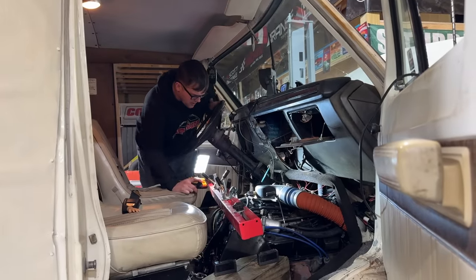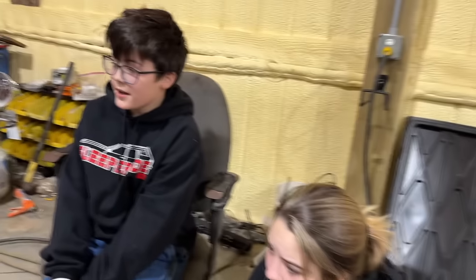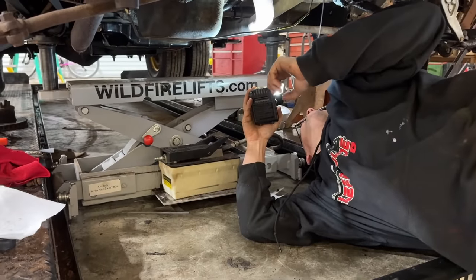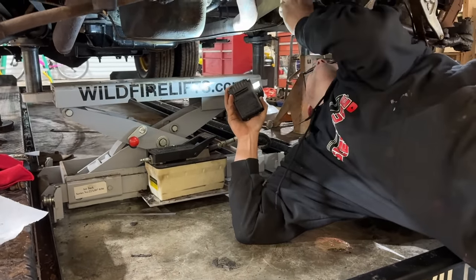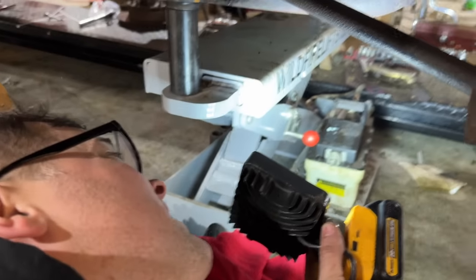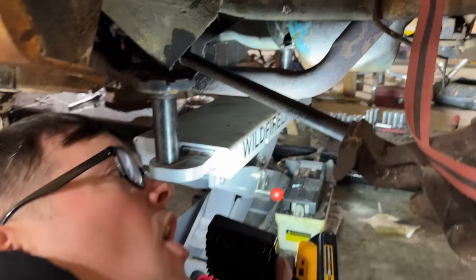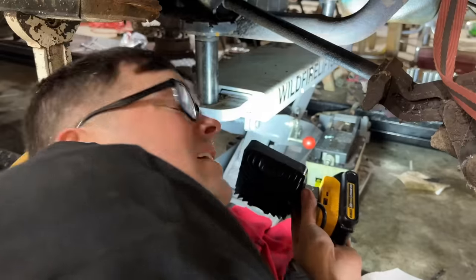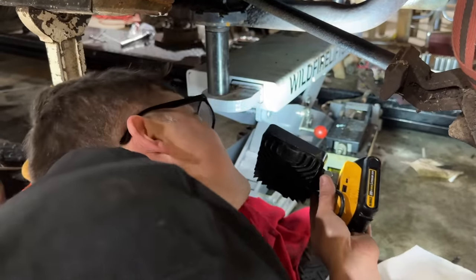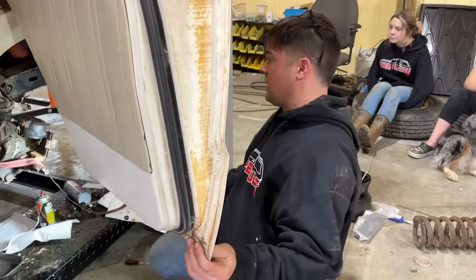Pounds of oil pressure again. Are we leaking? I don't see none, but I don't get it. Well, so far I'm not seeing anything. But it did leak a whole lot more once it warmed up. I think it blew a bunch of rust out of the back. 70 pounds at idle. That's crazy. We'll just let it run and warm up, see what it does.